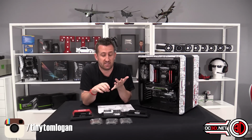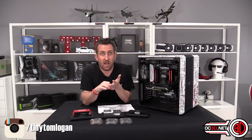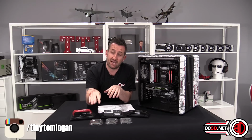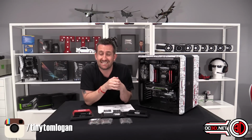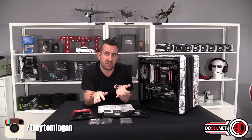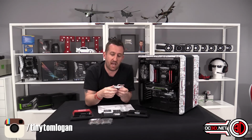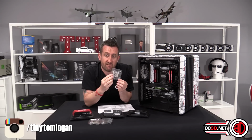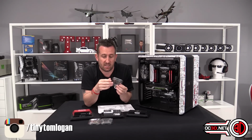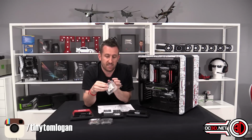I've told you about the 3400 megahertz memory, but our final clocks across the board, we ran 4.4 on all of them. The 6950X, which is the 10 core, and the 6900K, which is the 8 core, we actually then increased the cache multiplier as well, up to 35. The cache multiplier unlocks basically better scores with the memory. So you got that run at 3500 megahertz. And then with the little baby 6 core, the 6850K, we could only get the multiplier notched up to 34. So it was 3400 megahertz, 3.4 gigahertz, whatever you want to call it. So we did that.